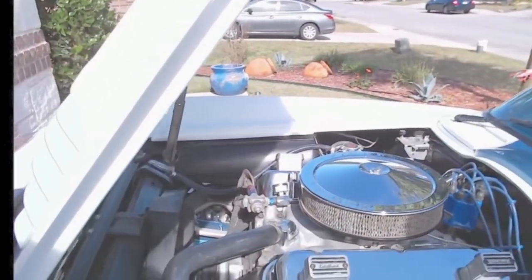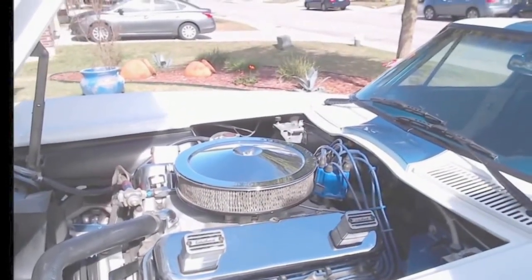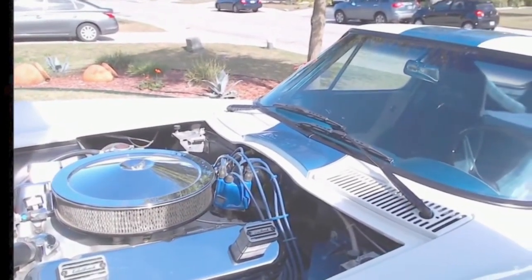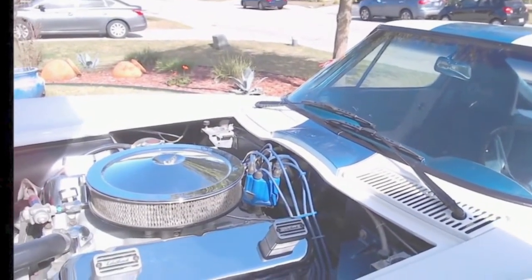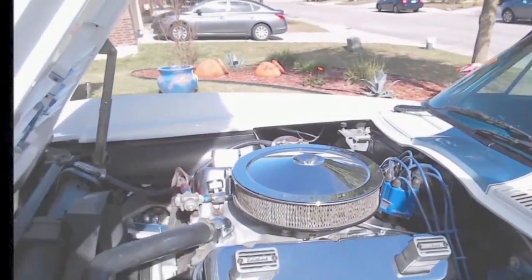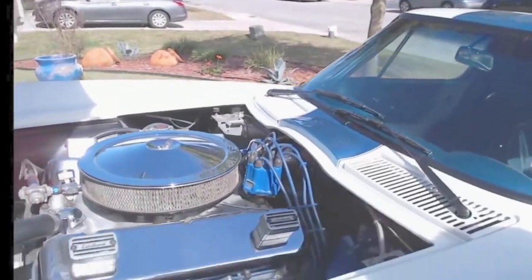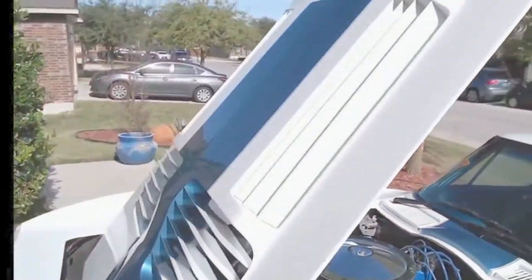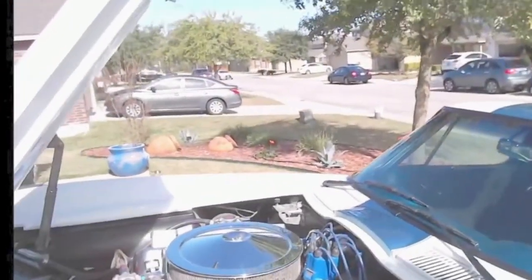Wow. It's gear drive instead of chain drive. What does that do for it? That adds more durability in the system, less apt to jump timing, where the chains can wear down, get loose, and develop other problems. This car also develops its top horsepower at 6,500 RPMs, which is a lot for a big block, especially a big block of this age.